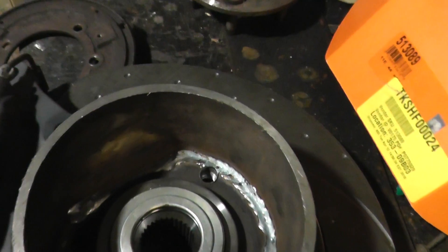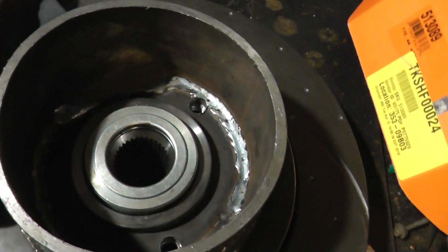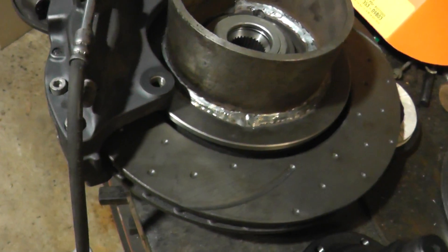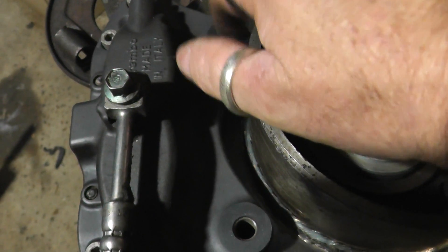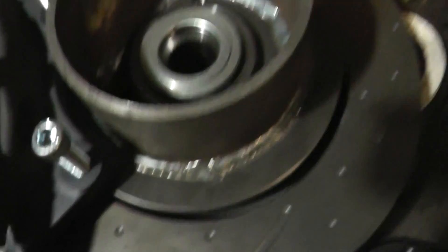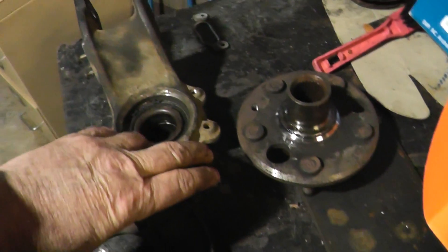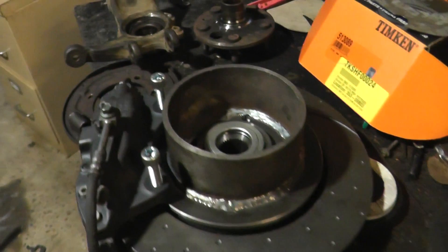There's a pie cut there so the lever can work from the handbrake mechanism. The Brembo caliper — what will happen is basically running a piece of steel around this part of the caliper, drilling through that piece straight into the caliper. After that, we'll be looking to duplicate some upper and lower suspension mounts and the steering arm on the back for the independent rear end.